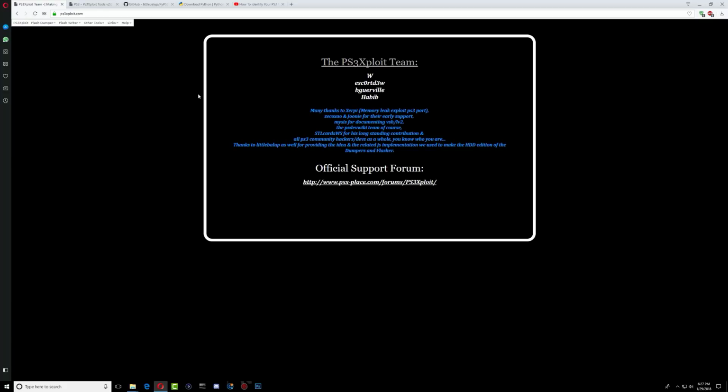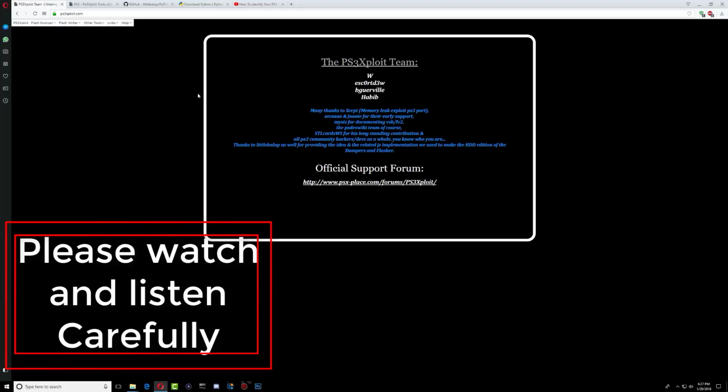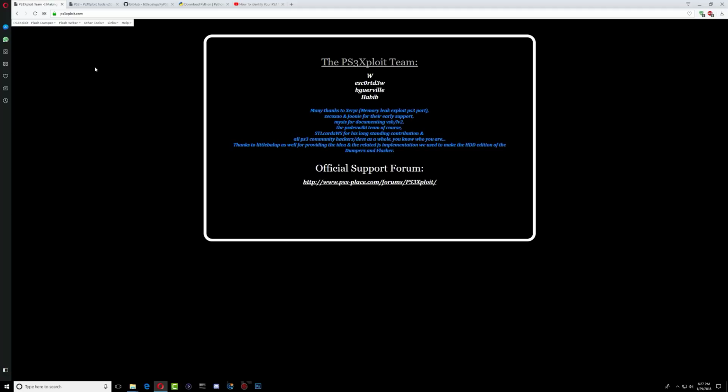So what we need from this page right now, we need to go and check our PS3 if it's capable of downgrading to 3.56 or even lower than that. So keep in mind 3.56 and lower is perfectly safe. Let me say it again. If your PS3 is able to go down to 3.56 and lower, then you are safe to do the jailbreak.